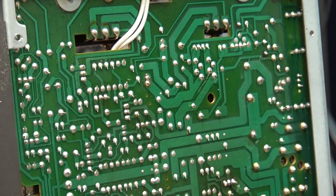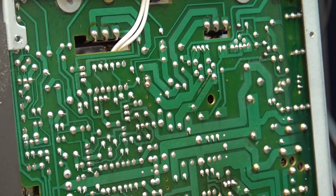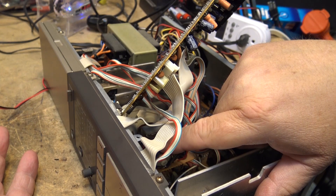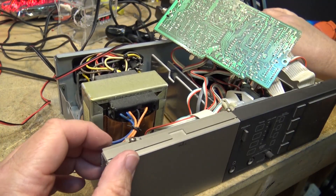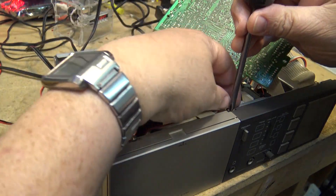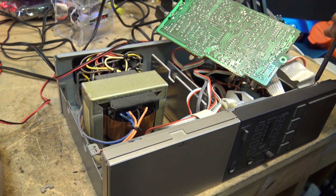I'm sorry I banged the camera there — that's what happens when your camera is mounted on a makeshift jib arm, which lets me get camera angles I would not normally be able to get. So now we need to tackle the other problem, and that problem is the motor. As I showed before, I've got voltage swing when I press the up and the down button but the motor is not turning. I notice the cabinet looks like it's been dropped because the plastic here is broken. These pieces are broken on this cabinet — I think this may have been dropped at some point.